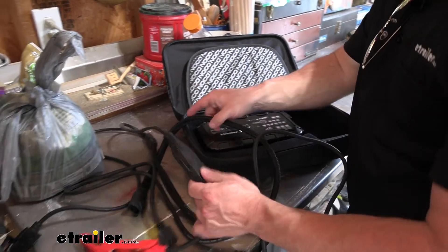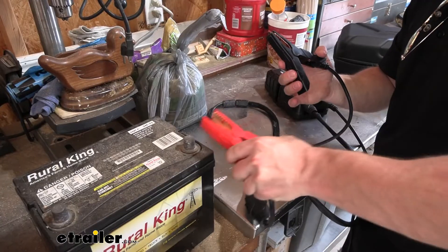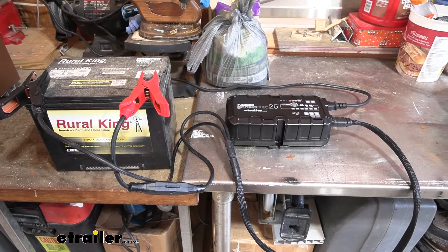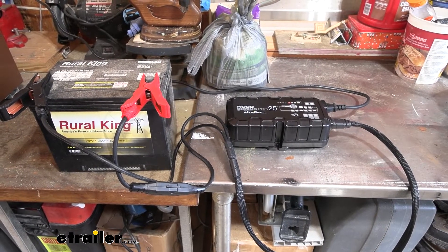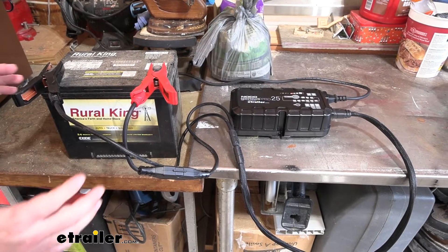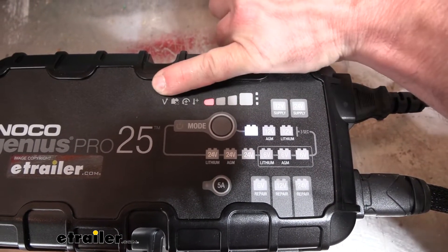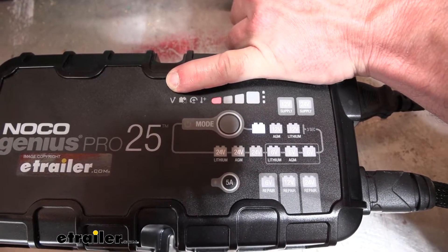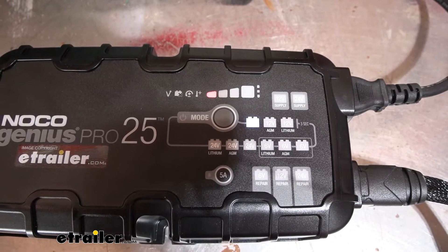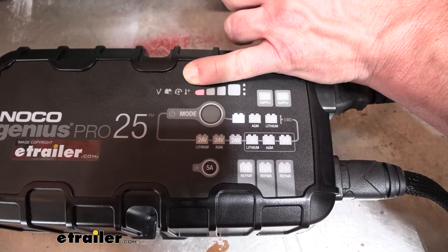We're going to use just the clamps because I have a battery sitting here that's been over the winter as well, not connected. So let's see what health it has. Give it a second to see where it's at as far as charge goes. The cables also have protection against reverse polarity — if you hook them up the wrong way, it will alert you and tell you to disconnect so it won't kick on and won't damage the battery or the charger. Looking at the interface: the top alert indicates if the voltage is wrong, next is a damaged battery indicator, then reverse polarity, and then if the battery is overheated you can disconnect it as well.